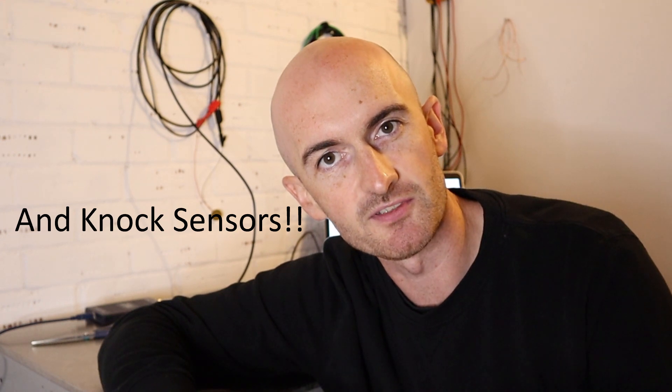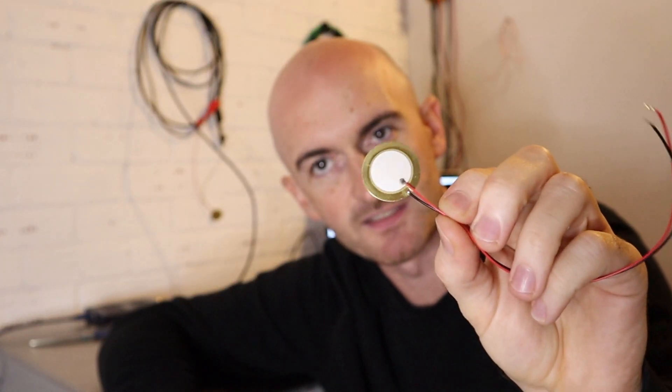These are really cool little things and they're used in a lot of places in everyday life like microphones and drum machines. You might have seen those vibration sensors like the chassis ears kit for picking up noises around the vehicle — I imagine it uses something similar. We also find this technology in diesel injectors. They're like electron sponges — when they get deformed or pressed it actually creates a voltage. In the diesel injector application, a voltage is applied to the piezo stack, it expands, and that's what it uses to open the injector.